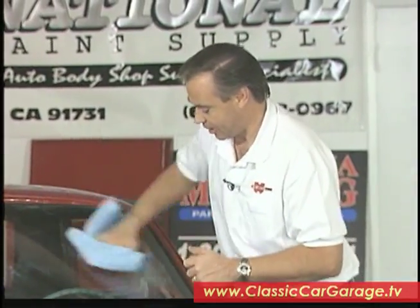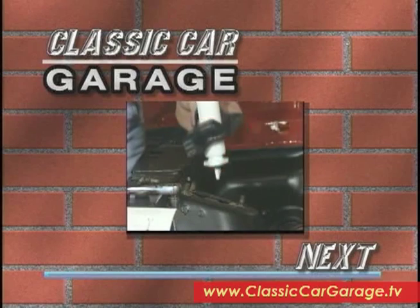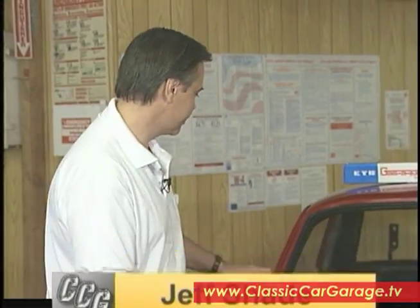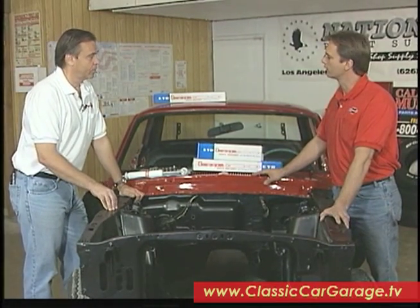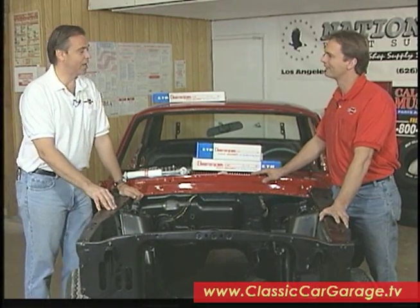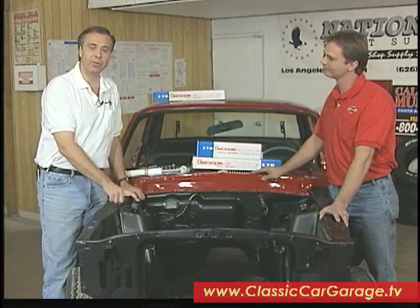When we come back here on Classic Car Garage, we're going to continue with the final restoration of our Project Mustang. Welcome back. Our windshield is looking pretty good, and it's going to take about 24 hours for this whole thing to set up. You can drive the car now, but you wouldn't want to go out in any rain until the 24-hour period where the urethane starts to take a set — might leak a little bit. We wouldn't want to spoil our windshield job by not being a little patient. On this part of the show, we're going to show you how to replace your shock absorbers.